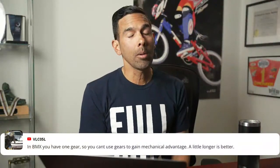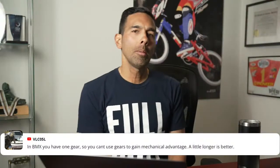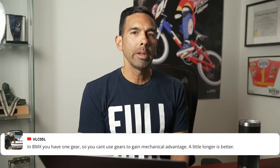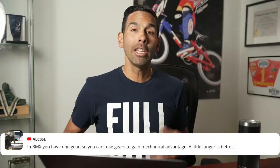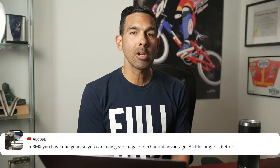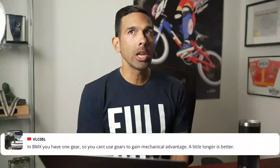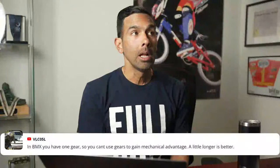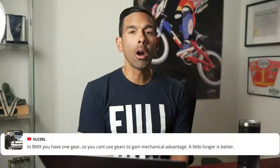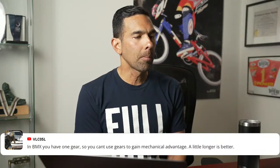I made the cut. And then we went down to San Diego and my boy, Terry Tinette, put 180 millimeter profile cranks on his track bike to try to gain a mechanical advantage overcoming a stand start, because doing a stand start on a track bike with a large 92 inch gear as opposed to like a 55 inch gear on a BMX bike with shorter cranks, super hard. It'll expose what kind of strength you got. Super, super hard. Much respect.